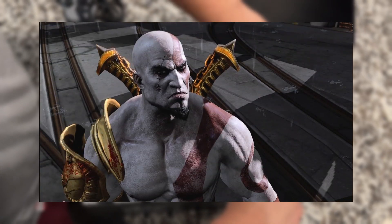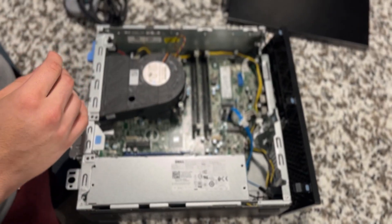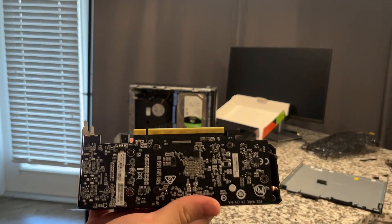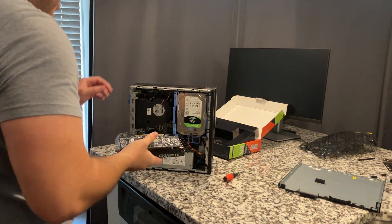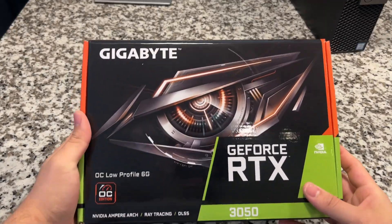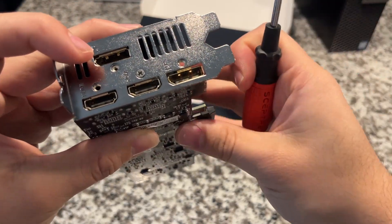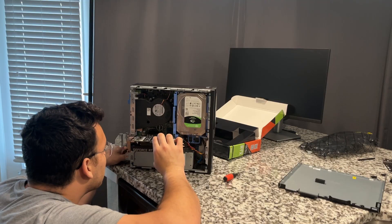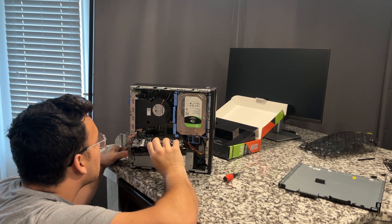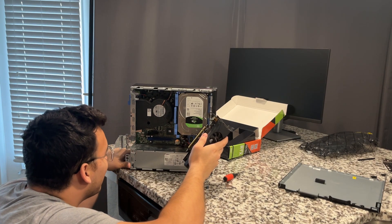After all, rendering Kratos' juicy pecs was sure to be a monstrous computational task. The solution I came up with was to buy a dedicated graphics card. I ended up going with the RTX 3050 low profile from Amazon, since I needed something decently powerful, budget-friendly-ish, and most importantly, small enough to fit in the small PC case. Once the new card came in, I swiftly swapped out the mounting bracket to the SFF version so it would fit. Unfortunately, when I went to place the GPU in, I didn't notice that the only PCIe slot available was at the bottom of the motherboard and there would be no space because the power supply was right underneath.